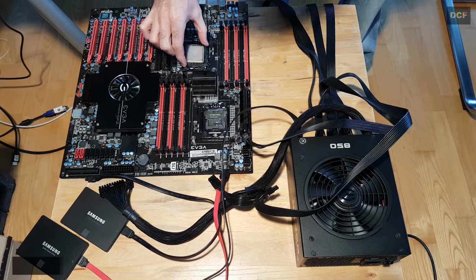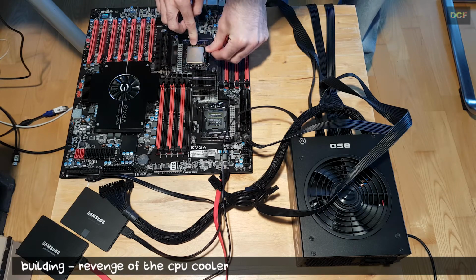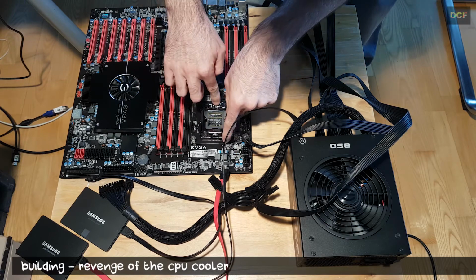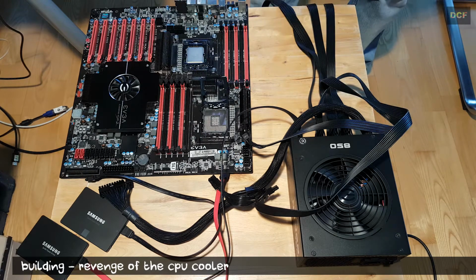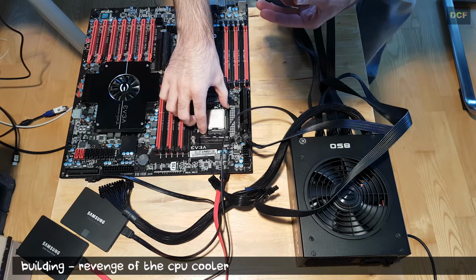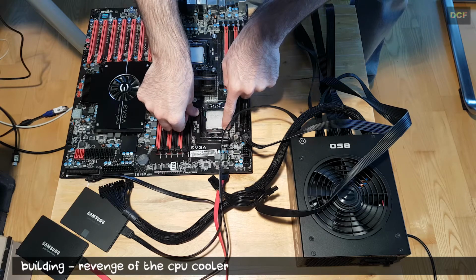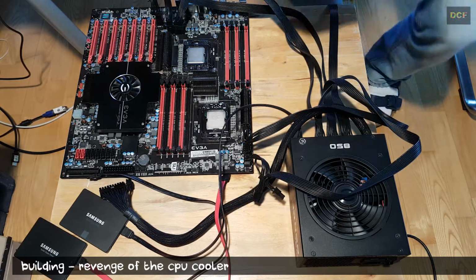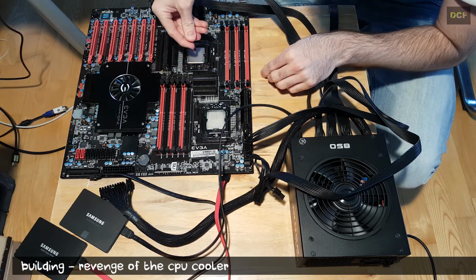But the bad cooling capability was not the worst part of the Arctic Freezer 13. The mounting mechanism of the CPU cooler was some sort of plastic rectangle you have to put on the board. In each corner of this rectangle you have to push pins through it. The edges of the corner had contact with the board, but there was something in the way and I didn't understand why I can't push the entire pin through the mounting hole. I looked and searched, but I couldn't find out what was wrong. I had this problem with 3 out of 8 mounting holes of the 2 rectangles, but I managed to push every pin through it, and I was happy.